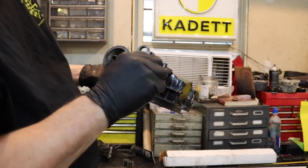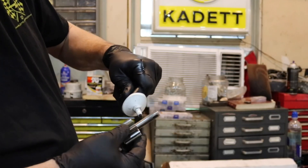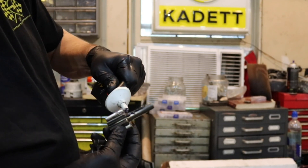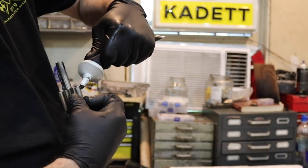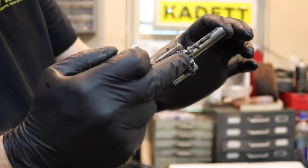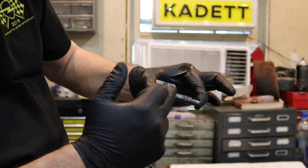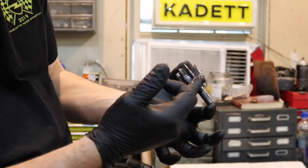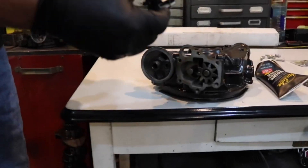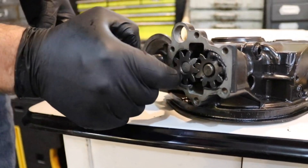The other gear slides in the same way. One of the tricks I do when putting the motor together is I put gear lube — this break-in lube — along the shaft and on the upper part of the gears, just a little bit. This primes your oil pump, so during the start-up cycle or even during the first crank-up it will help prime the pump and you'll also have nice wear on your gears. Then you just put it in and get them to go together — you can see they're already pumping the lube.